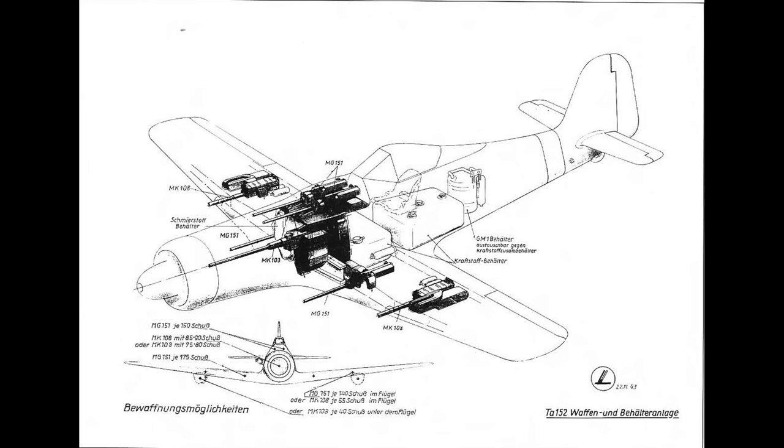Now, these systems are very simple. There's an 85-liter storage tank behind the cockpit. When activated, nitrous from that system sprays into the supercharger inlet. At that point, the pressure drop turns it back into a gas. It goes through the supercharger, it goes through the intercooler, and into the engine. And yes, you can spray nitrous oxide through an intercooler because it's in a gaseous form.